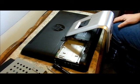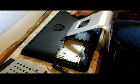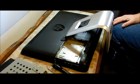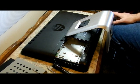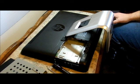I hope you liked the video. It's a nice clean system. Once he gets a hard drive in, we're going to load it up and it'll work fine for him. Everything else checked good with diagnostics. If you have one of these and need to check diagnostics, at boot up hit F9 and it'll go through checking everything. If your hard drive comes up with a smart failure, it may be too late to recover your data — so back up your data on a normal basis. Check out my video on SkyDrive, a perfect cloud to put all your stuff on. I hope you liked the video — subscribe if you want and share with a friend.